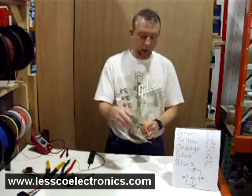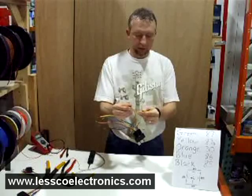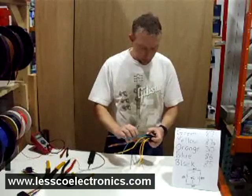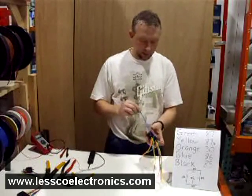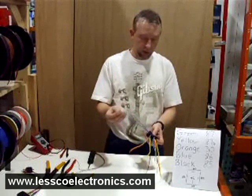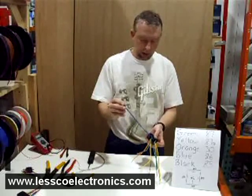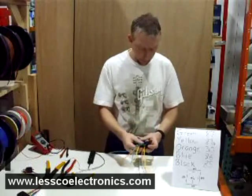You would have to cut the wire and put these relays in line through the relay for them to work. These two blue wires are going to be the negative outputs either from your alarm or your switch. If you're repairing your door lock switch you'd use the switch; if you're using a car alarm or remote starter, you'll use these as the negative outputs from your car alarm. We'll leave those here for the time being.